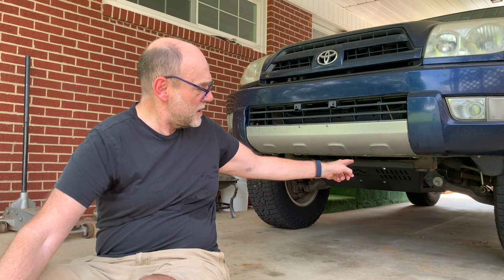And so the access plate here for the oil filter, it doesn't line up if you've got a V8. But just checking my one after I got it installed here, the oil filter is just to the right here behind the plate, and I think I can pretty easily just reach up in there and grab it, and with a rag or some cardboard just pull it out and catch the slop, so that's not a big deal. And then the oil drain plug in the back, it does line up, so the hole there does line up with the oil drain plug. It will probably take about a 3 or 4 inch socket extension to reach up in there, so I may look at getting an adapter to redirect that flow through a vinyl tube or something just to make it a little easier. But it's not a big deal right now.